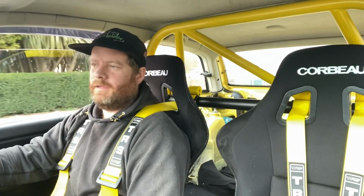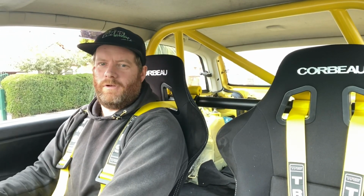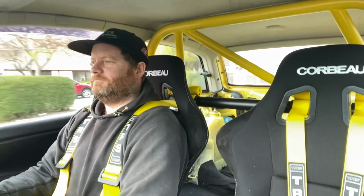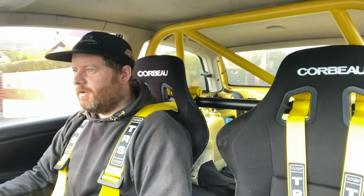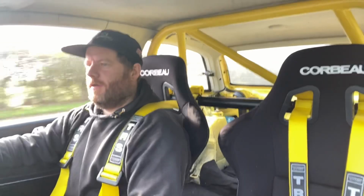Kind of annoying exhaust rattle, but it was just the screamer pipe touching on the subframe. So I just put it on the ramp and adjusted that. Doesn't do it anymore. A few more noises here and there, but nothing we need to bother about. Sun's out, gun's out.